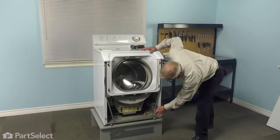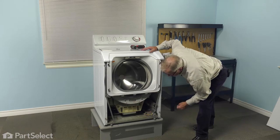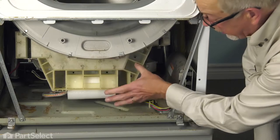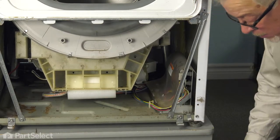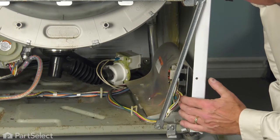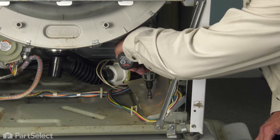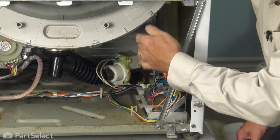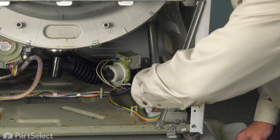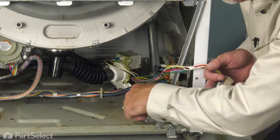Now our next step will be to disconnect the harnesses to that motor control board and remove the screws that secure the board and housing to the base. Although it's not necessary, we are going to remove this lower counterweight to make it a little easier to get at the motor and make it easier for you to see how the repair goes. We now have a clear view of the motor connection harness and the motor control board. Next, we'll remove the wire harness from the motor control board. If you wish, you can remove the screw that holds that shield in place. That will give you better access to the actual terminals. Just pull those all off of the existing board and then thread them out of the wire harness retainer in the base.